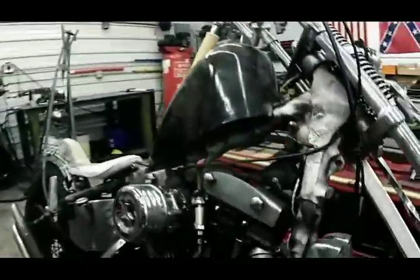Even most Evos and Sporties come with solid push rods, but you can get aftermarket adjustable ones in there, which I recommend, just because I like to work on things. The stock solids will wear out after a while and you'll start getting really bad slap in them. Plus, if you want to run a hot cam or you've had a little bit of motor work done, you're going to run adjustable push rods because they're adjustable. Essentially, though, it's still the same concept, the same procedure. Any bike that has adjustable push rods, that's pretty much the same procedure for all of them.